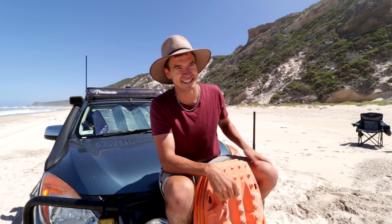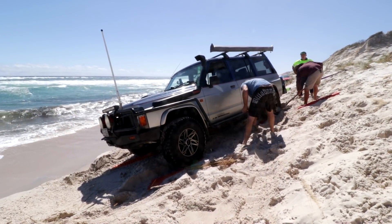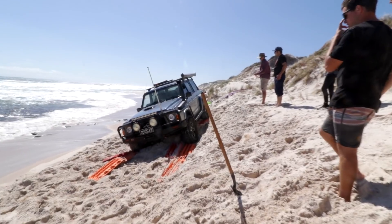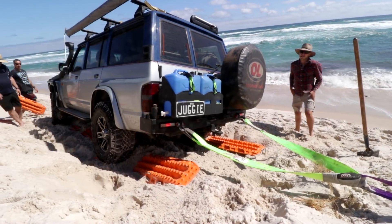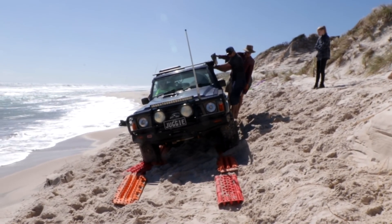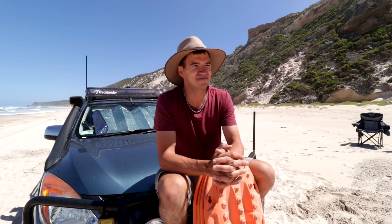Justin said I could totally use this footage as long as I didn't bag him out too much. In this situation, if we could have used the front winch on his car just to hold his front end up — because there was quite a bit of an angle on the section he was stuck on — it would have been a lot easier to winch him backwards without the front of the car sliding down. We did manage to use my winch to pull him backwards and the Maxtrax to support the weight of the car, which worked fairly well. But it would have been easier if we could have buried the Maxtrax over the hill and used the front winch to hold the front of the car so it couldn't slip towards the edge of the erosion bank. That's a real-world situation where this technique would be good to use.